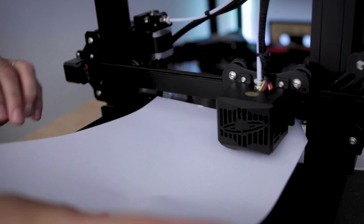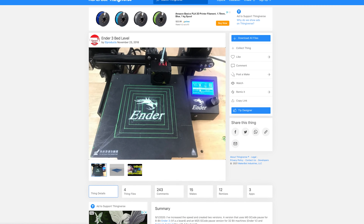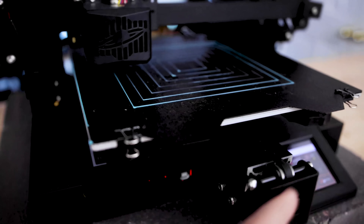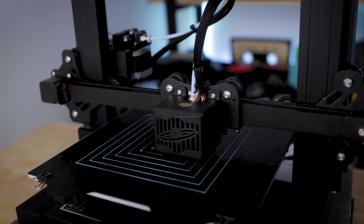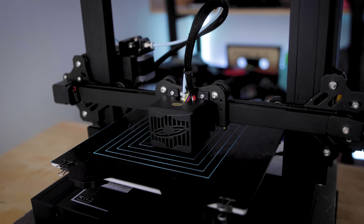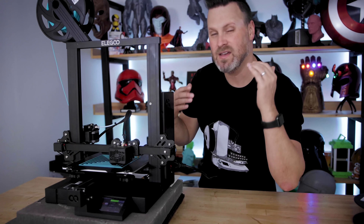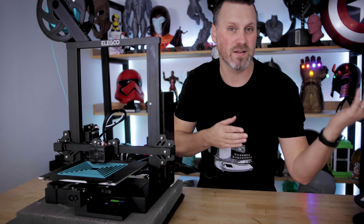And that works fine for the most part. However, there is an amazing file out there created by Chep3D that you can download off of Thingiverse or off of his website that will give you a direct G-code file that you can load onto the Neptune 2 and just run off and print. It's going to go all around the build plate — which I'm printing right now — and confirm that your build plate is level. The great thing is that at any point in time, you can adjust the knobs as it's running through this test print. It's a really quick test print and you don't even need to run the full thing. As long as you see that it's sticking in all the main areas, you can stop the print and move on.